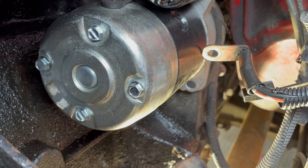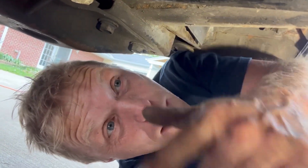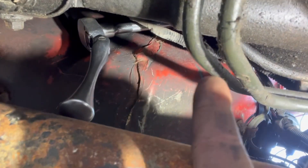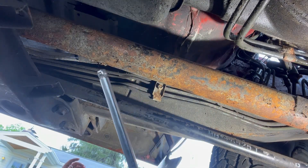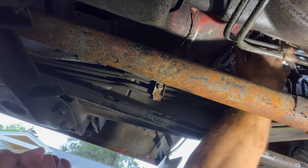I've been able to finally get something on this top bolt. What I needed is a 14mm wobble socket with a wobble extension and a shorty flex-head 3/8 ratchet. Then I can turn it about an eighth of a turn at a time, taking about 20 minutes to get this thing going. Here's my shorty ratchet — the extension's right above that, going up to where that starter is. You can't see anything after that because there's no room.